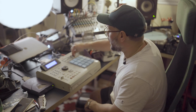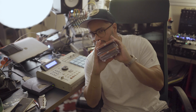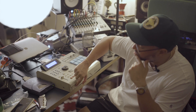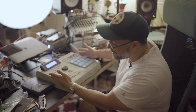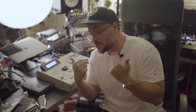Alright, that's it — everything's working. Shoutout to MPC Stuff for making it, ugly as hell but it works. Looks like I'm not gonna really need the zip drives and floppies anymore — not getting rid of them though, there's treasure in there. One thing I forgot to mention: using the SCSI port means you don't have to crack the machine open to install anything, and you keep your floppy drive, which maintains the MPC's value. Hope this video was helpful — peace, I'm out.